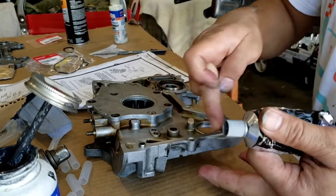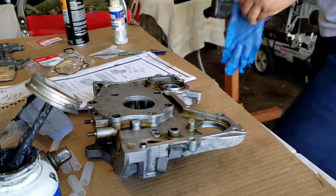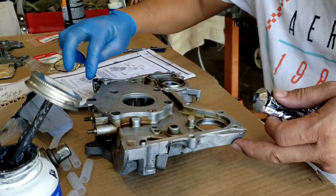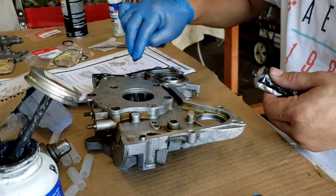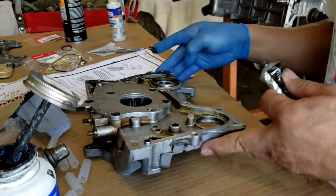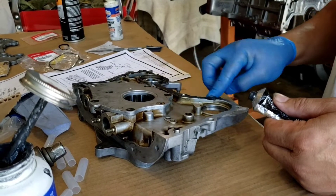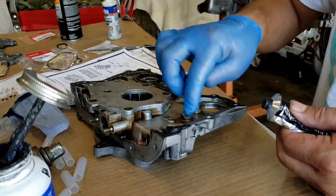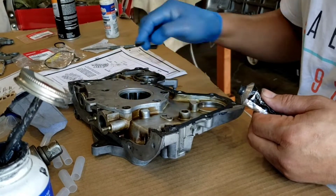Same thing — just make sure there's no damage on the flange, and put a little bit of sealant on there. As far as the sealant is concerned, it's nice to use Honda Bond, but I found something that's almost similar to it. You smear some on the o-rings — that's fine, it's not going to go anywhere.